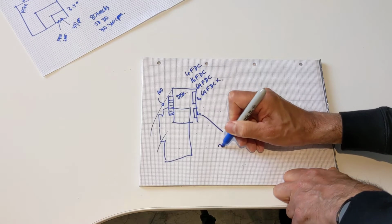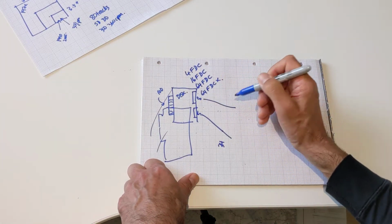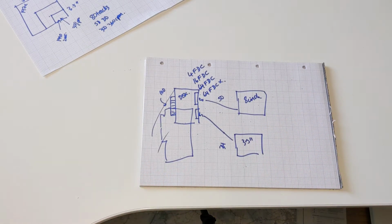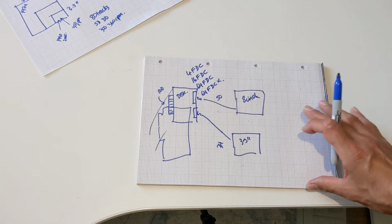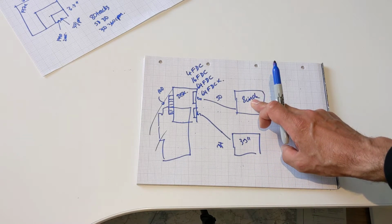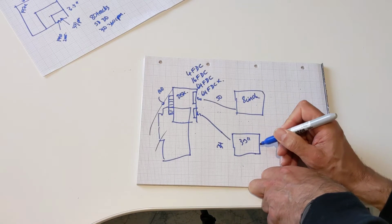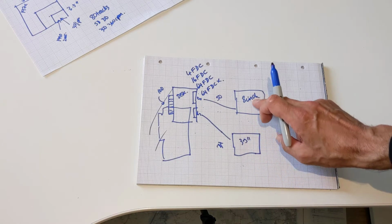So what you'd have is a 34-way ribbon cable going to the 5-inch drives, and another cable, I think it's a 50-way cable, going to your 8-inch drives. So this is 8-inch drives here, and this is 3.5-inch drives. So the cunning plan was to take these Japanese drives, which are 3.5 inches physically, and rewire the hardware on the drive to always look like an 8-inch drive. So that was done by firstly modifying the drive itself here to always spin at 360. So there's a hardware modification that makes this drive only spin at 360 RPM. So this guy will always look like an 8-inch drive.